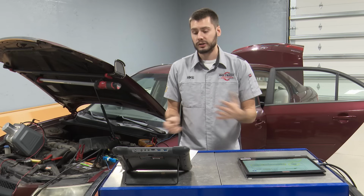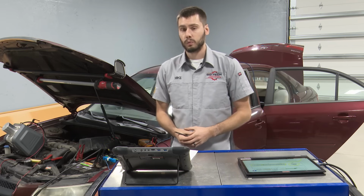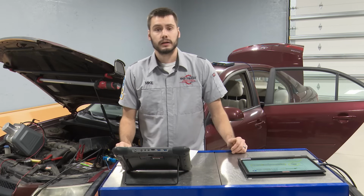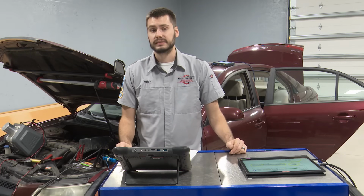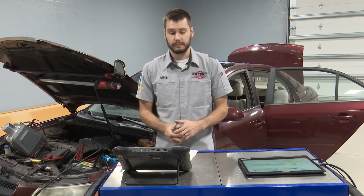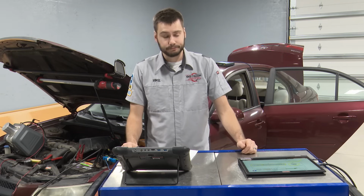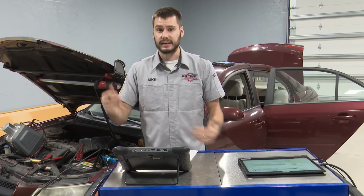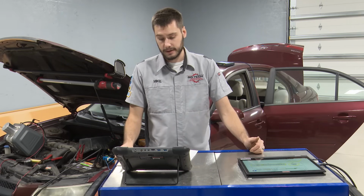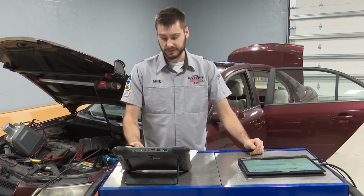And that's going to be common when you're using a scan tool test like this, because it's not doing the true in-depth EVAP leakage test that we're going to be doing when we hook up the smoke machine and actually check the system for leaks. It's not doing the system leakage test that it would be doing when the vehicle is operating either. This is just something that makes sure that we're not dealing with a large leak, but at no point here does it actually shut it off and bring that vacuum way low and just let the system sit and see if it decays. It just doesn't do that with this test, okay? So inconclusive results from that, which leads me to actually performing some testing.